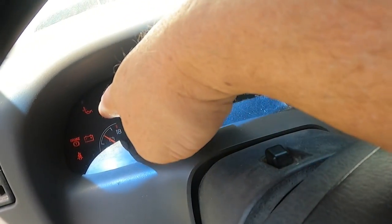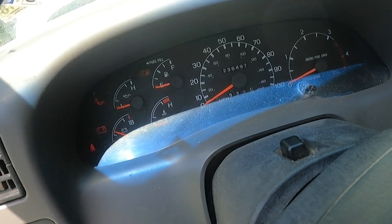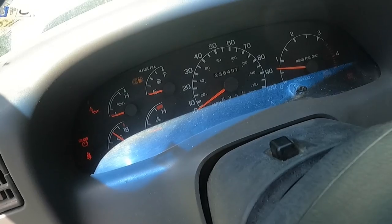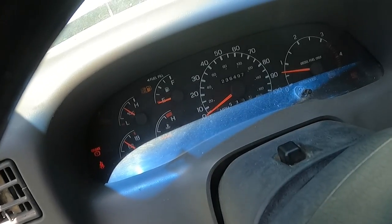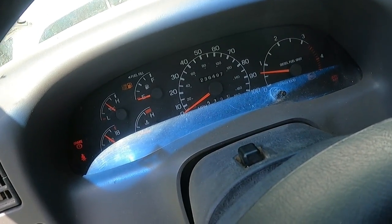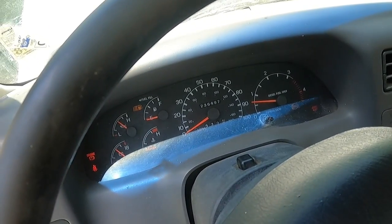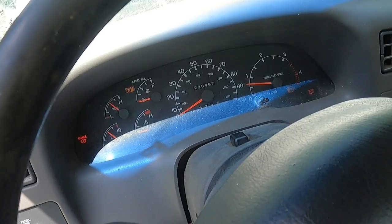And keep an eye on that oil pressure, because the faster the oil pressure comes up, the faster the HPOP will get oil. Well, there's our oil pressure. And the HPOP being filled up allowed it to pressure up. I didn't have the scanner on it, but I'm guaranteeing if we had our scanner hooked up and been looking at the HPOP pressure, we would have seen it climb from a couple hundred up to 2200 or so and fire up.